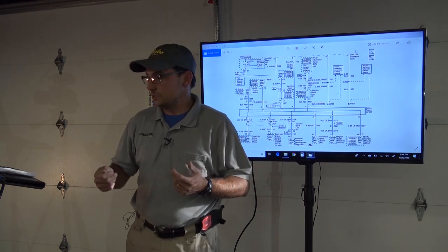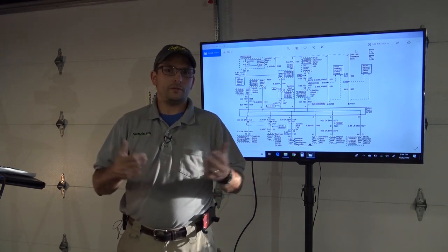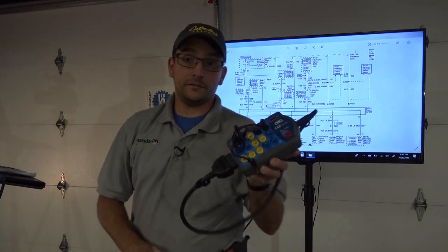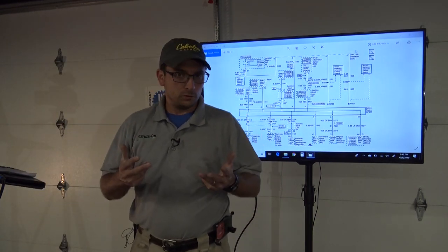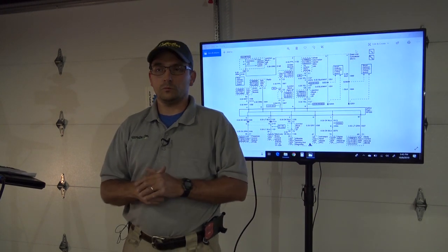We had no communication. So that's always a big thing when you guys are diagnosing vehicles. Always, if you have no communication, you know we got a problem. This is where quick testing at the DLC comes in handy with the DLC breakout box. So pins 4 and 5, we had no voltage between them. That's always good. Pin 16 was battery positive, and that's good as well.